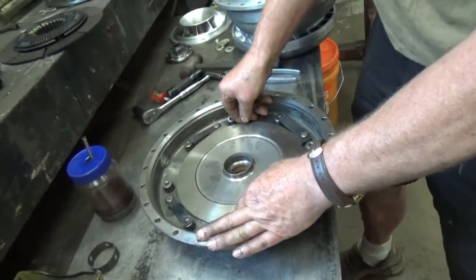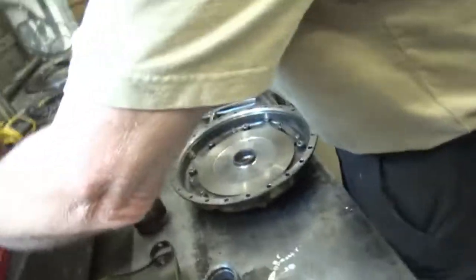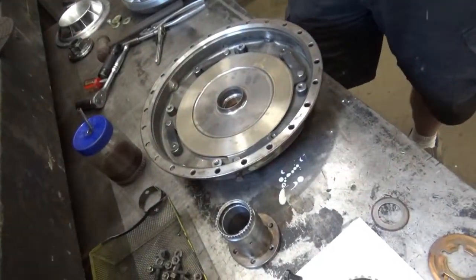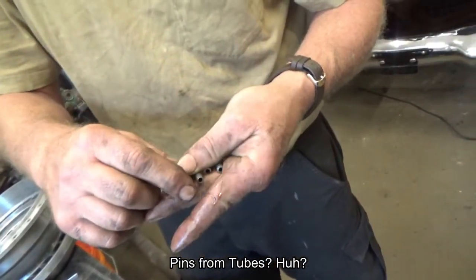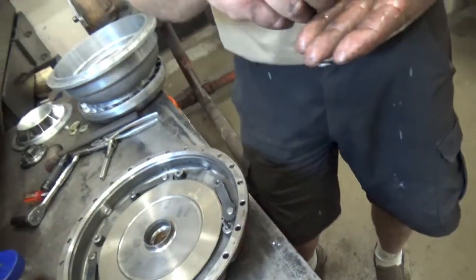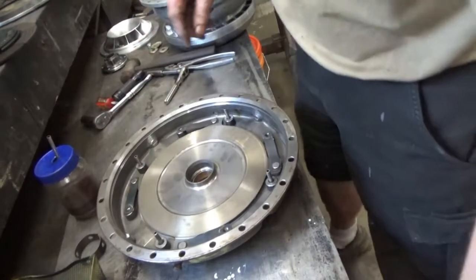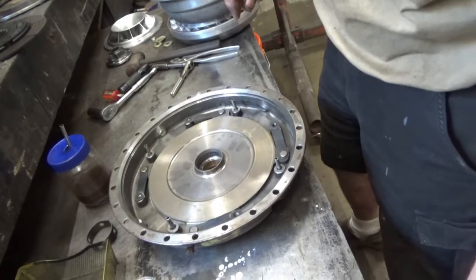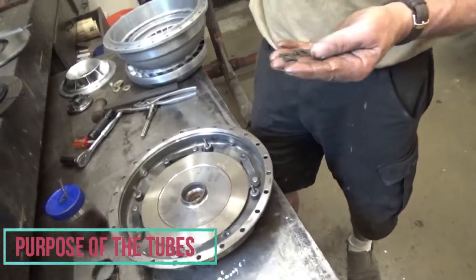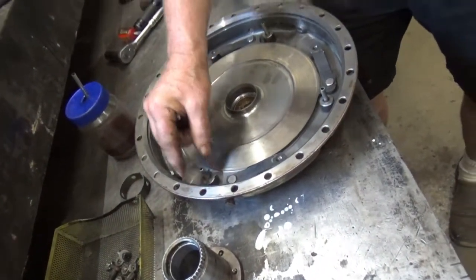And the thing just basically drops into its hole — there's absolutely no rocket science involved whatsoever. So it's good to have a set of these little pins made up. I just made them out of little pieces of leftover quarter-inch brake tubing, and they just drop down in these holes here. It serves two purposes: it helps us to install the rest of the clutch, but it also helps to hold these little spacers in place so they don't go walkabouts while we are assembling.